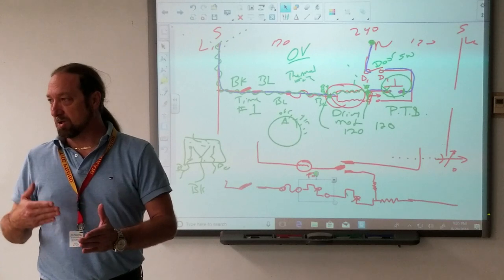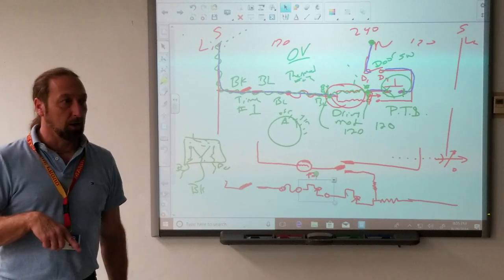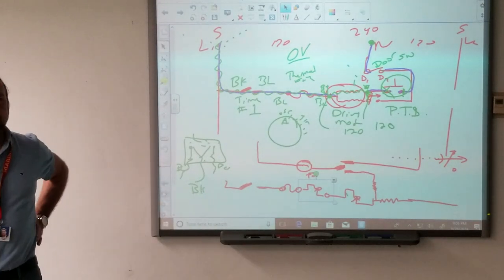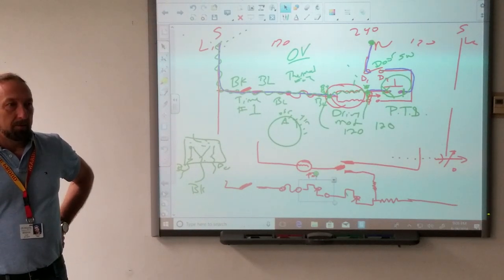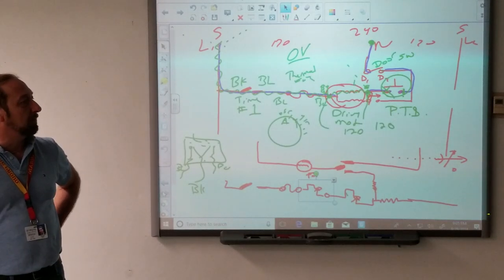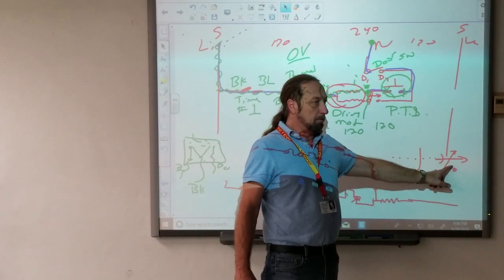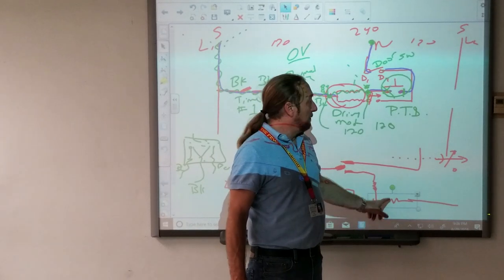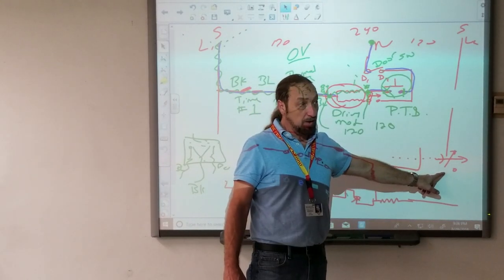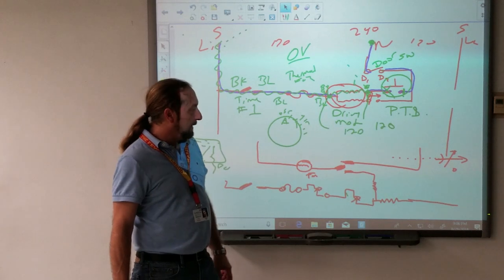Appliances for the most part are that way until you get into computerized, electronic machines. Let's start off with the basic switches and controls. I'm going to stop this lecture now unless anybody has questions, and we're going to do the light bulb circuit after that. I'm going to give you guys some practice tomorrow. Yes — for the centrifugal switch, when does that activate for the heater? And the 1M and 2M? That turns on the heater, but that switch doesn't close unless the motor's running.